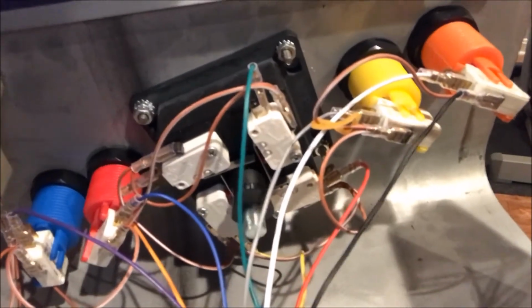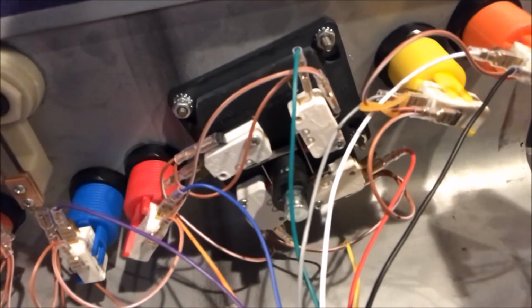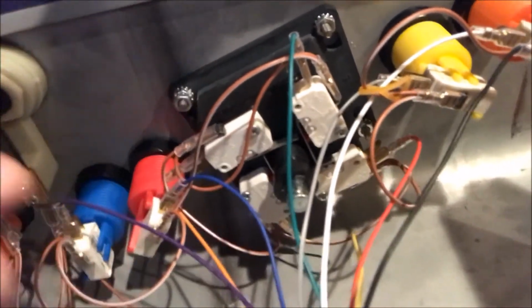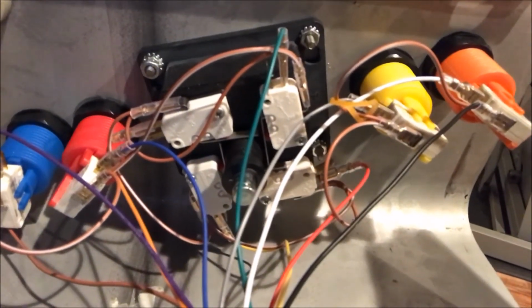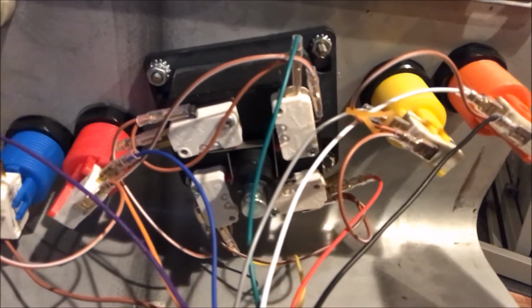And then your joystick has four switches on it. So when you move it up, you're pressing one button. When you move it left, you push another switch. When you go right, you push another switch. When you go down, you press a different switch. And those switches all make a connection and send a signal back to the computer board, and it tells you, oh, player one hit button one, player one's joystick hit the up switch, so it moves your player or fires your weapon or whatever it does.